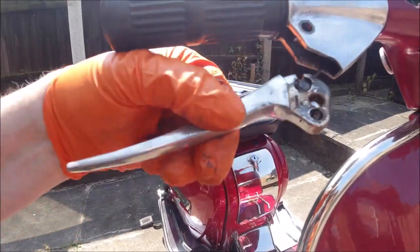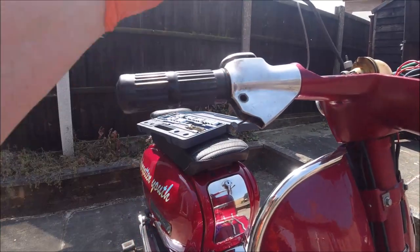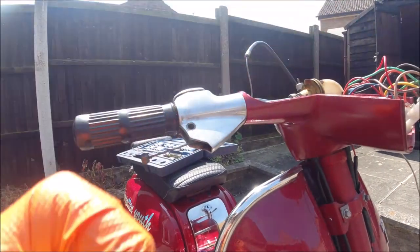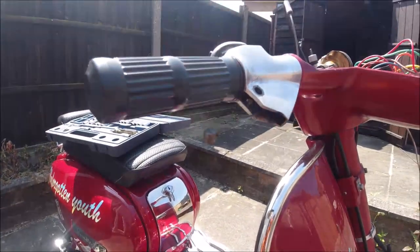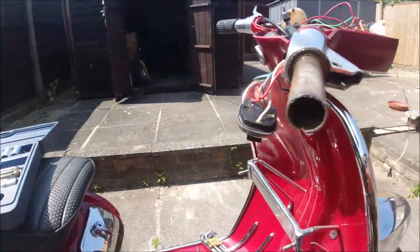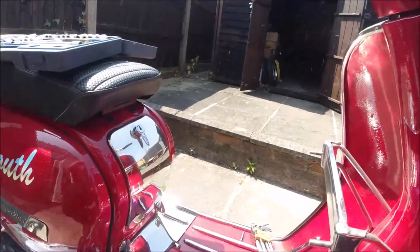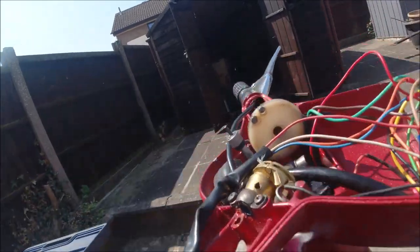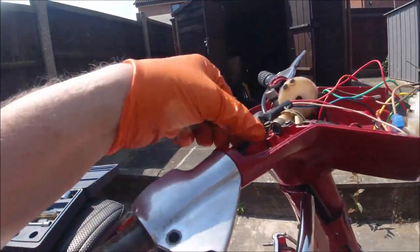That's out. Now I can just pull this cable up and along, and then pull this one down. Now we have the rod pulled out. You just undo that, or if it's got the GP one it's got a pin that goes through there — just knock the pin through. If they're nylon like that, knock the pin through and then just pull it out this way; that gives you better access to pull your cable through.